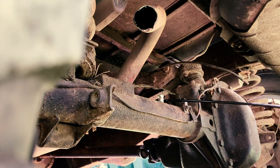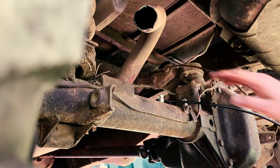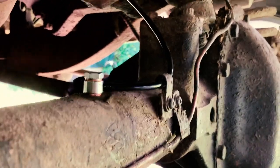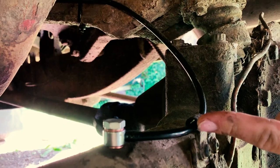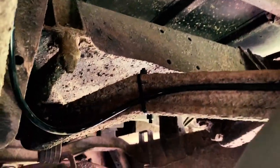That's looking great. This will then feed up here. This is the old breather here - look at that, that's handy, should have spotted that a while ago. So I'm going to cut the cable ties off that run up the body and replace them with fresh ones here. That'll wrap round and then jobs are getting there. Done - this is done up nice and tight, not too tight. I've also daisy-chained some cable ties together, attached it in there nicely, and secured it up at the top, out of the way so no water ever gets into it ever again.